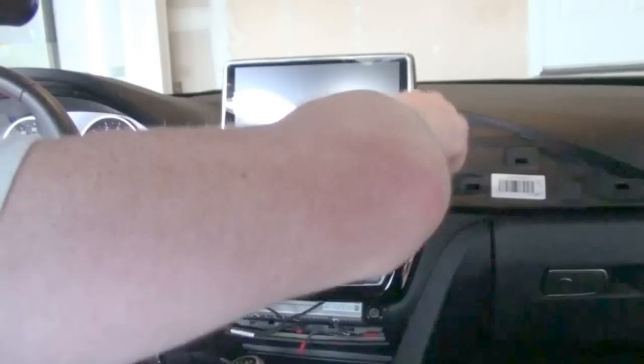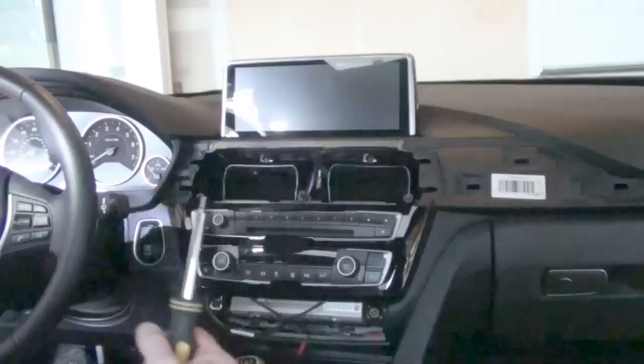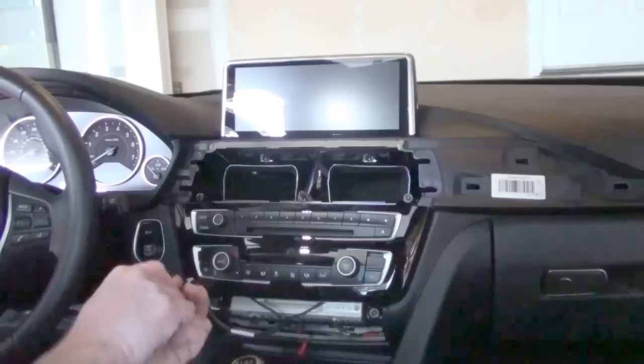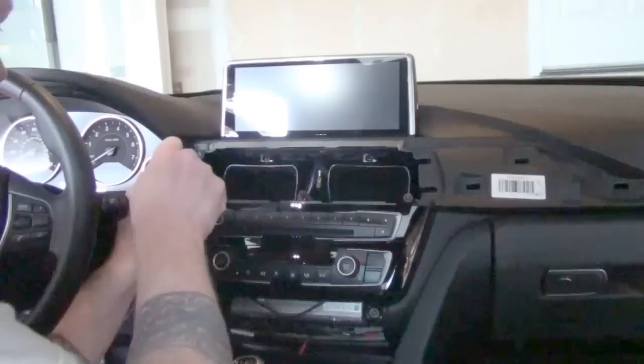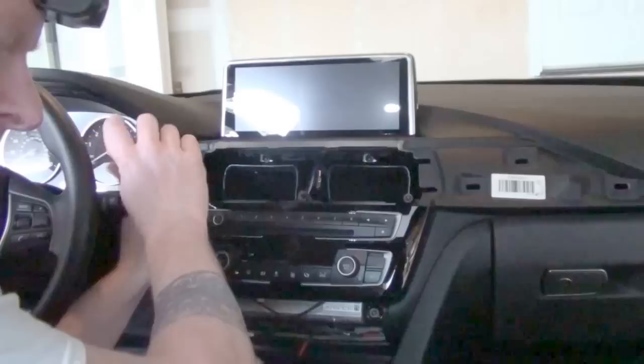Take the upper piece, plug it back in so your controls work — plug only goes one way, snaps right into place. This trim piece walks right back into place with four screws to get it in the right place. Data cable's in, head unit is back in place, trim is going back into place as it should. The display has the proper screws in place. Our GPS antenna is in place and connected.